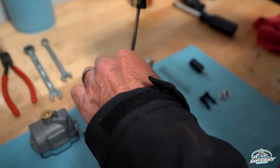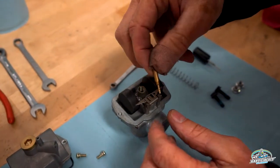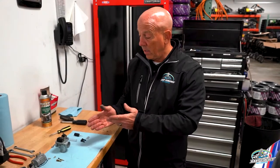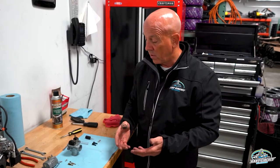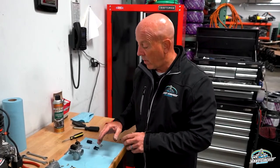The easiest way to clean these parts is to actually soak them — I would say soak them at least overnight. Keep in mind that you're not always going to have to do it to this level, but this carburetor had been sitting for a couple of years. If you're racing your cart frequently and just want to keep it clean, you can remove these parts, spray some carburetor cleaner or brake cleaner in there, and reassemble the carburetor.